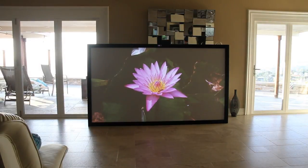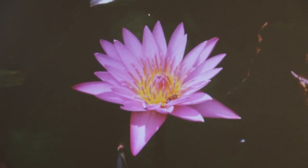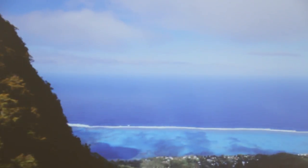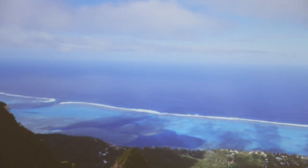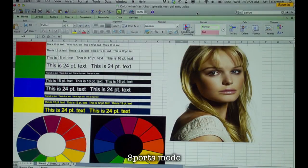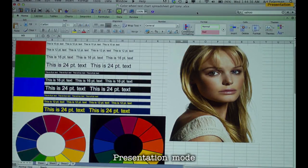Here are some examples to give you an idea of how much ambient light the G6900 can really tackle. Unfortunately we don't have a screen larger than 100-inch diagonal outside of our theaters. This screen is a 1.1-gain 100-inch and it's not a screen designed to deal with this type of room — sorry about that. This quick sequence of photos demonstrates the relative color differences of the different modes starting with Theater, then sRGB, Sports, Presentation, and Dynamic modes. All look very reasonable with only Dynamic being off — too much green — which is typical for most projectors' dynamic modes.